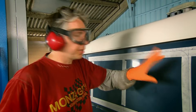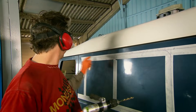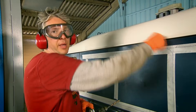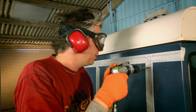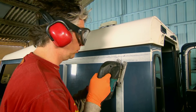The observant among you will probably realise that the windows have rounded edges, so I've found something with the same radius — a roll of masking tape — and I'll use that as a template on each corner. Might as well keep it simple. For these corners I'm going to cut first using a jigsaw. Before I can use the jigsaw I need to get the blade in, so I'm drilling a hole at the beginning of each of those cuts — bearing in mind the lumpy edge, I need to go that way with the cut. It just means I can make a nice easy start. It's jigsaw time — no going back after this. We're off.